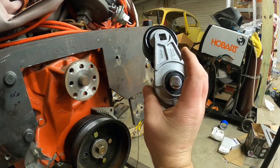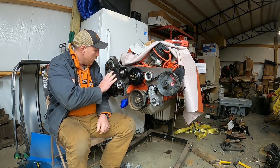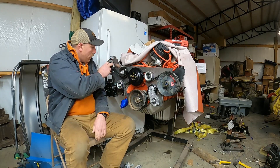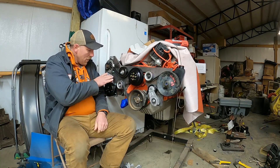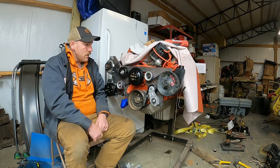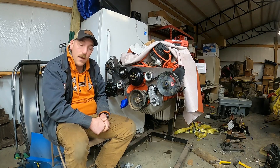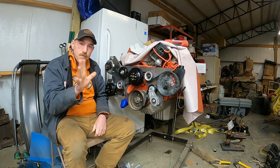That's it for tonight's video. I hope you enjoyed my method to my madness — I'm building my own serpentine system for one of these Caddy motors. I still have a few things to do: clean up a couple of pulleys, order a new alternator since this one is old and used, finish up some welds, clean everything up, and paint it to keep it from corroding since it's mostly bare steel. I'll try to do a short video when I get it all cleaned up and looking nice. Thank you — please don't forget to like and subscribe and we'll catch you on the next one.